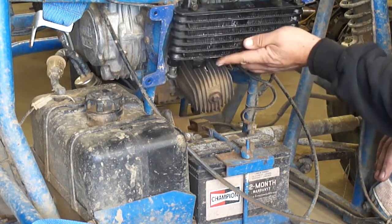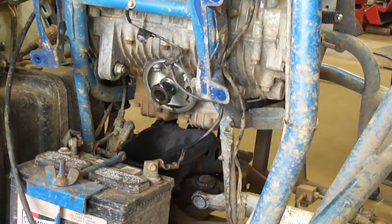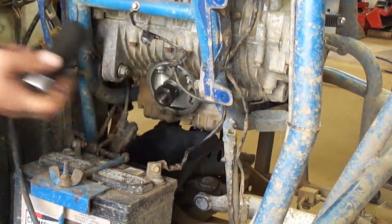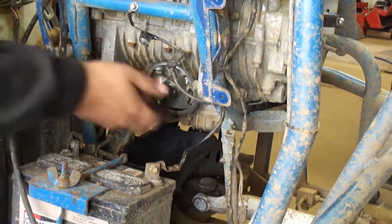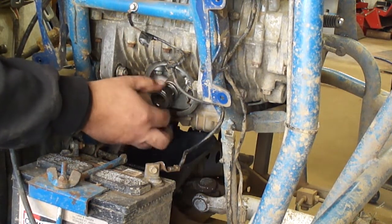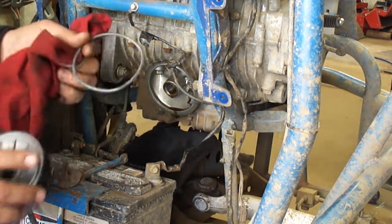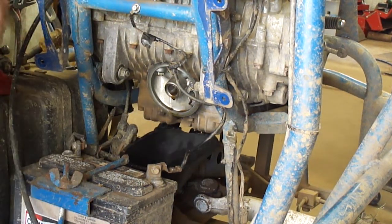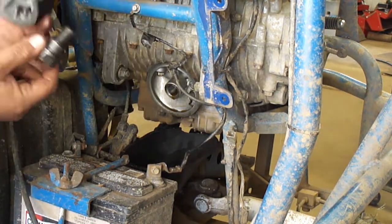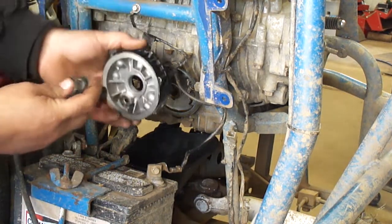Not gonna fit. All right, I thought before I got too carried away, I'd pull the oil filter housing off and see if that adapter is even gonna work on here. So there's this strange nut in here that I've taken loose. The other adapter comes with its own nut bolt thing. And I do have a new O-ring for this. Get some oil on it real quick here. Flip that in. Okay, this is the nut bolt thing and washer that come with this.